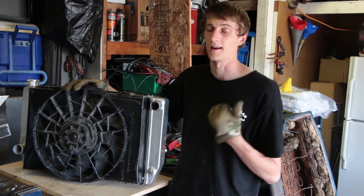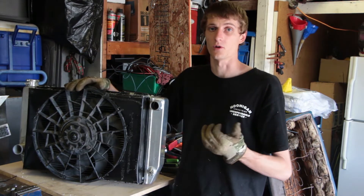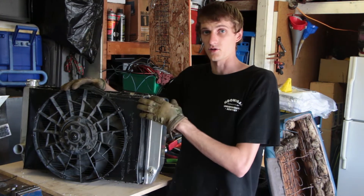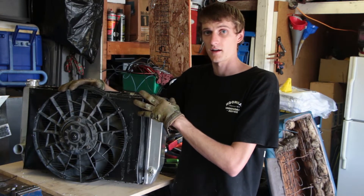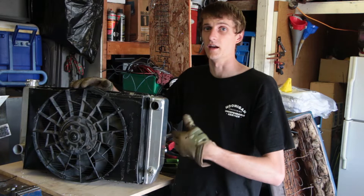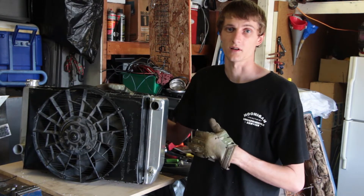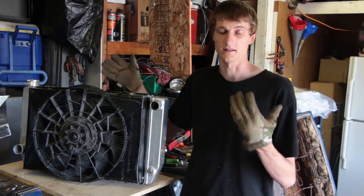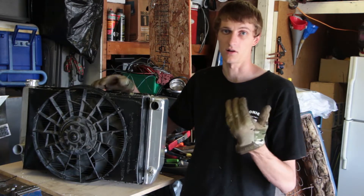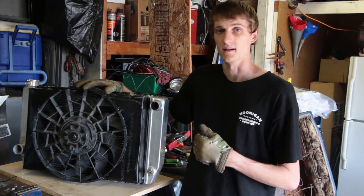This thing definitely feels really solid and I'm really stoked about using it. Last time at the track I would only get five laps before the car was so hot that I would have to cool it off. But with this new fan shroud and this new radiator fan I should be covering about 25% more of the radiator fins and pulling another 35% more air through. I can't wait to see how much cooler it keeps the car and how much longer I can stay on track.